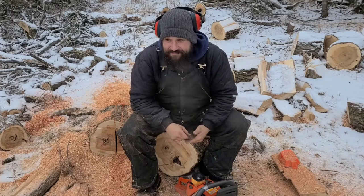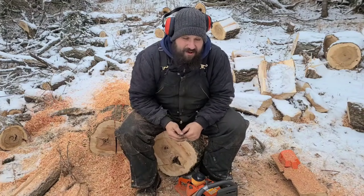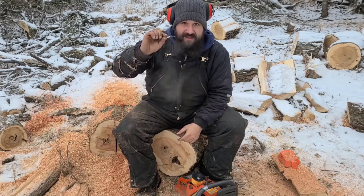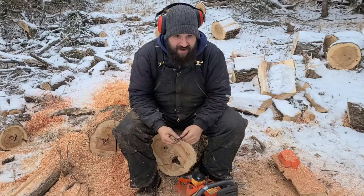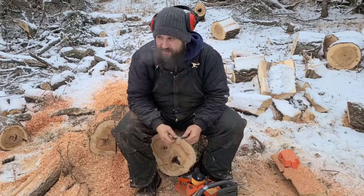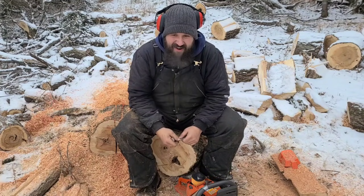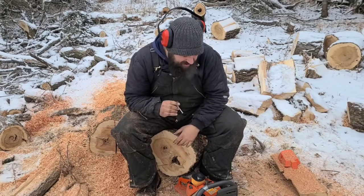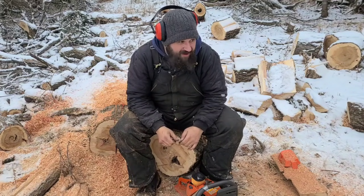Okay guys, there you go. I hope I answered most of your questions. Started about 1 1/4, 1 1/4, uses little idle screws, and you know, that should get you in the ballpark with most saws, not all. Some of them are funky. 576 XP is like 2 1/4 on the high and low or something silly like that. But most older saws, pre-emission saws, you will get in the ballpark at 1 1/4.